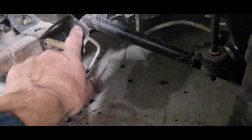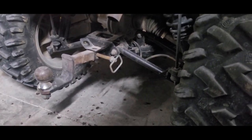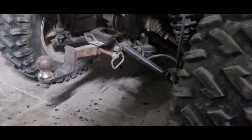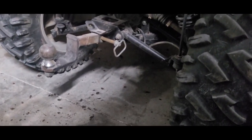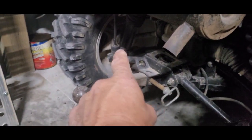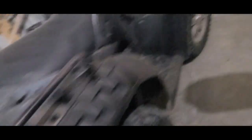Try to pull on this to check that the bushings aren't worn out. On some Polaris models those tend to go out because people don't grease them. If people would grease these things they'd never go out. You can feel if the outer bearing is bad. On independent suspension you've got eight CVs to look at.